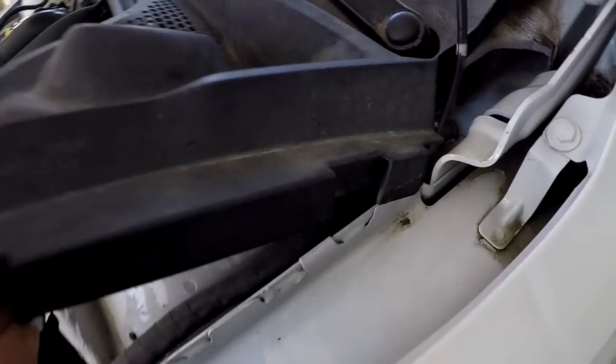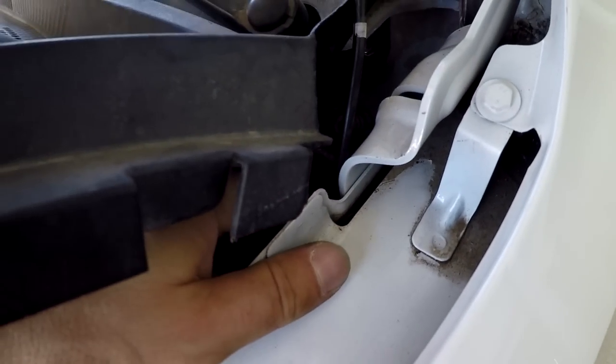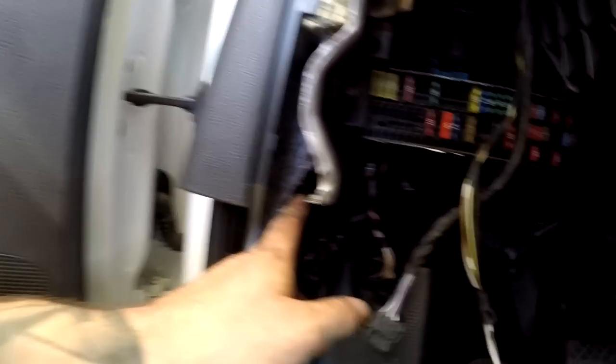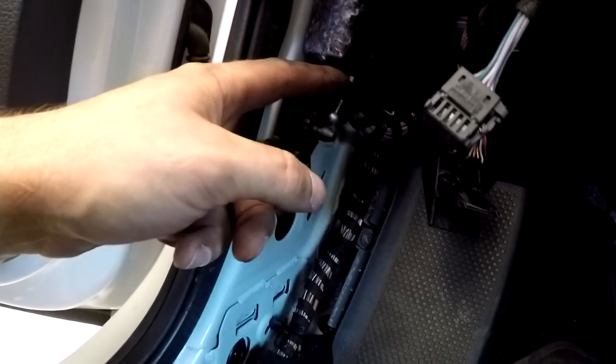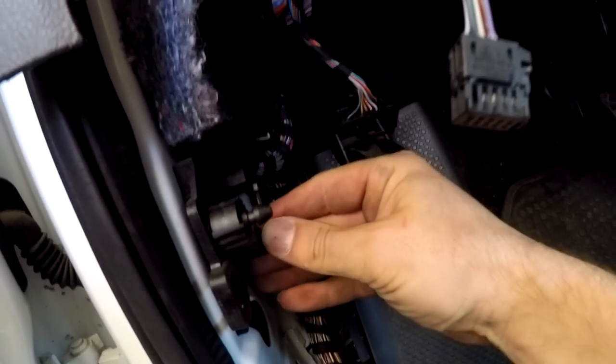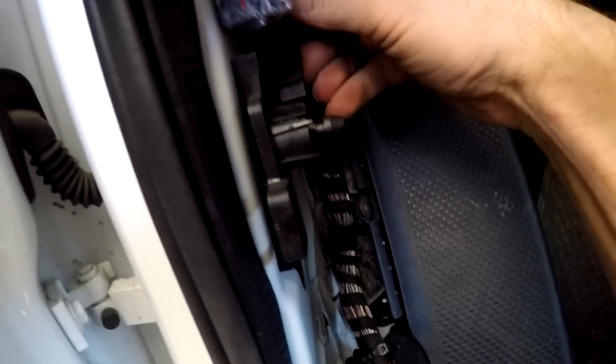So that's out. The grommet just pops in through there into the inner fender. Once you're shoving the new cable through, you want to end up with the cable close to the latch. Getting the handle off is the hardest part — there's a little latch you have to lift up. You kind of have to use a small screwdriver to pry that little latch out, because that's the mechanism that holds it in place. Otherwise you'll be fighting to get it out.